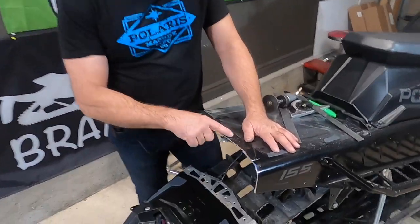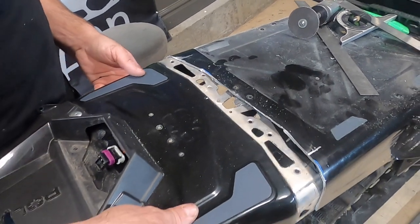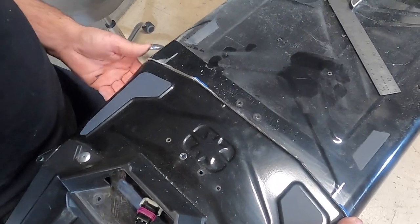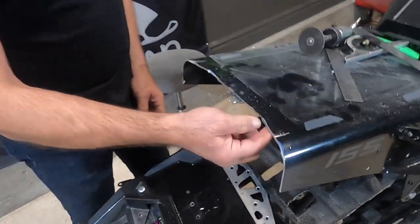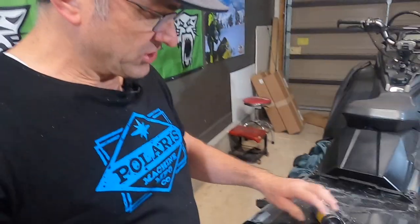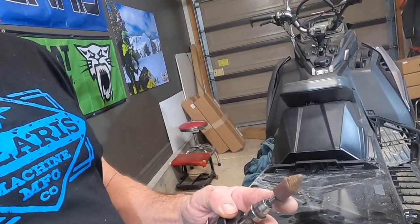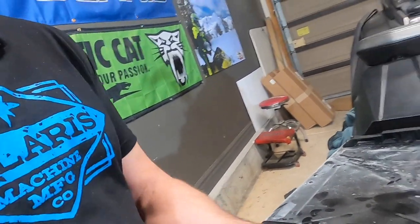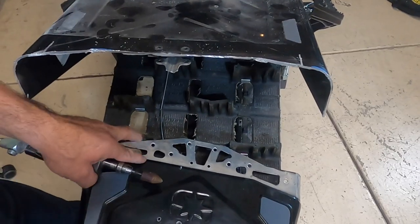Now we got it all cut off. I had to take out those two rivets so I could slide this back in there. We're going to just trial fit this and see how we did. It looks pretty dang good as far as fitting back on. We're going to have to come back and just clean up this edge because I left a little material here — clean that up on the top and the bottom. Now that we've got this chopped off and trial fit, I'm just going to take this grinder with 180-grit sandpaper and clean off this edge, make sure it's nice and smooth so it fits together nicely. Then we're going to install the tunnel extension.